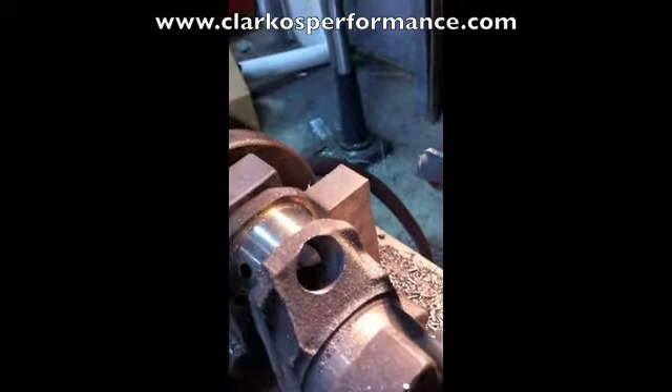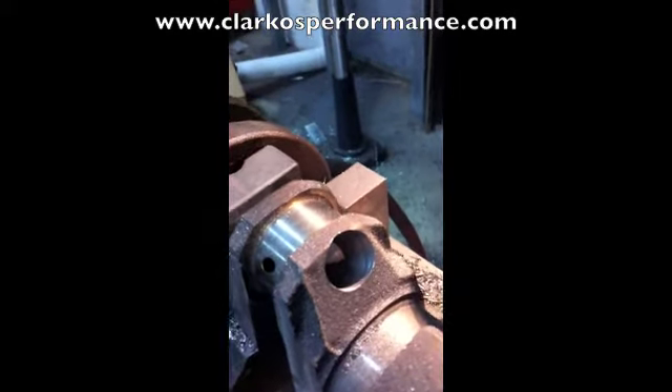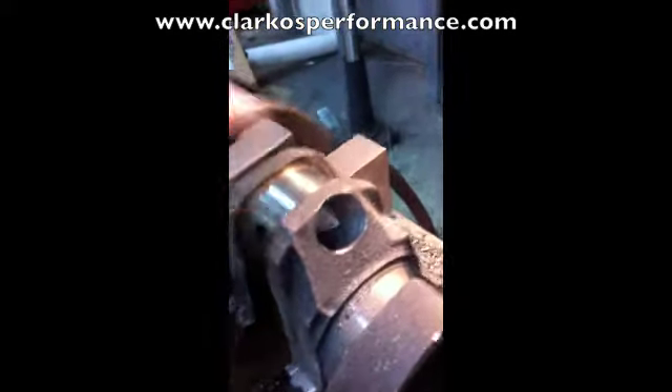To our required depth. Stay tuned. As you can see, we've got a nice big hole which used to be solid. I'll do all this side first, then I'll turn the crank around, drill from the other side, and then we'll have a nice lightened little end.